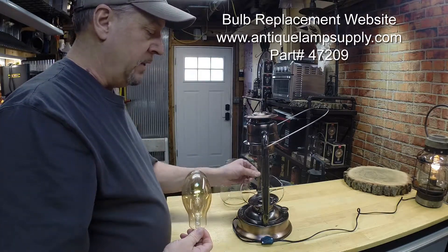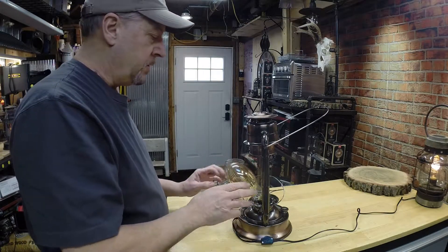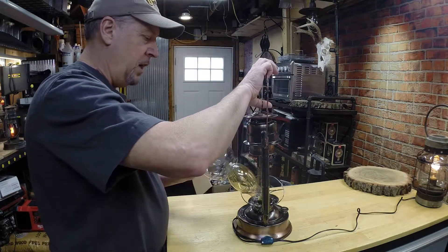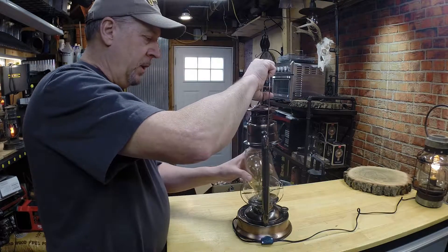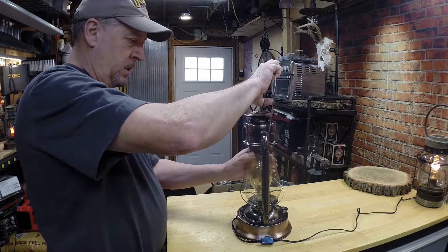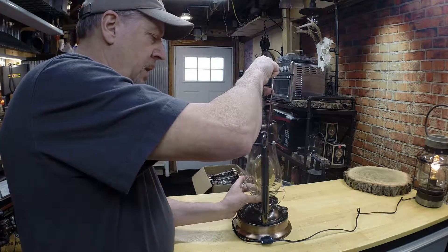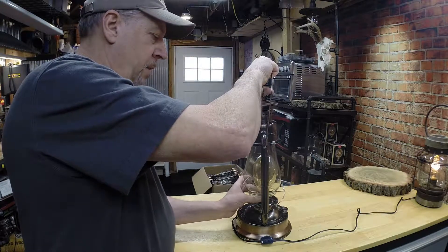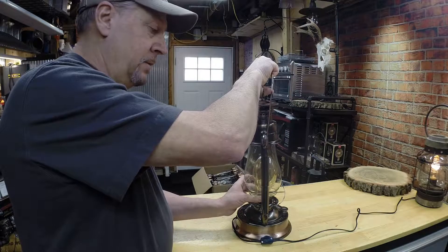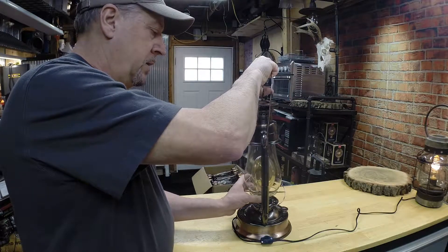When you get your replacement bulb, go ahead and set that platform so that it's flat, and you're going to just rest that bulb in there so that it's just at an angle, and you're going to slip that chimney over the oversized bulb, and you're going to lift your chimney assembly up. Just get that thing seated in there, and then you're just going to repeat that process. You bring your glass up with the chimney assembly, and you're going to very carefully just screw that bulb in there. Be patient — sometimes things just take a little practice — and just screw that in so that it's nice and snug.